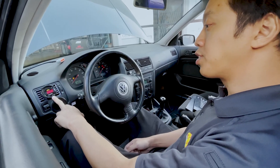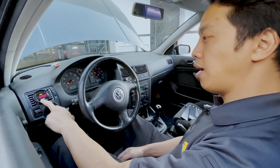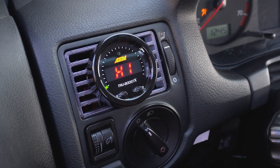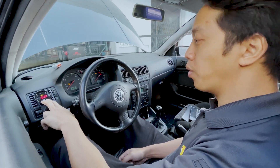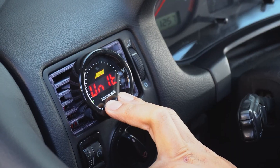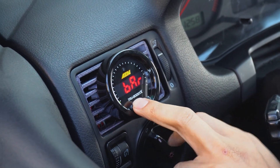Now that we have all the hardware set up, let's move to the car and work on the gauge setup. On the front of the TrueBoost X gauge you'll find two buttons. Button A lets you cycle between your two different boost settings, A and B, or turn the gauge off. If you just press the button it'll show your current boost setting; if you hold it down for three seconds it'll cycle between A, B, and off. The right button will show your highest boost value achieved since the last key cycle. To get into the setup menu, hold both buttons down for three seconds, then hold again for three seconds. From there you can set your units — we'll be working with PSI.